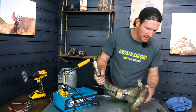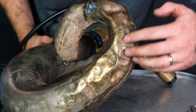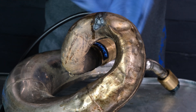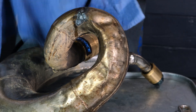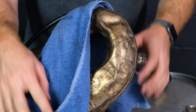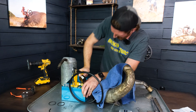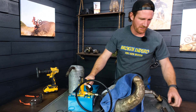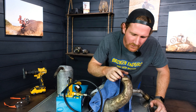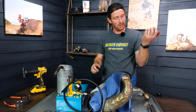The biggest dent is right here — the one I couldn't get out last time — plus some others down here. With these pinholes they're going to spray like crazy, so I'm going to drape something over. I'm hitting like 650, 700 PSI. That one popped out right there! These ones are better too. Take a breather and hit another set.